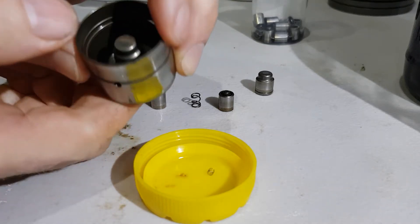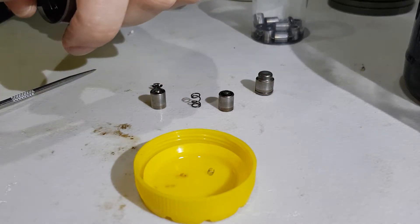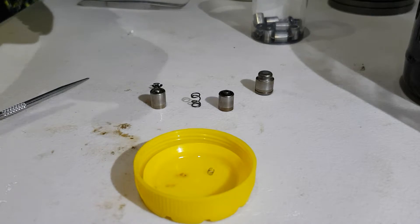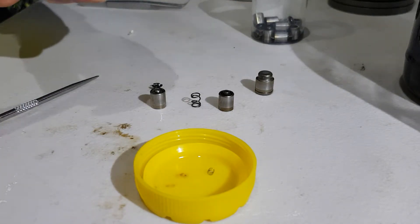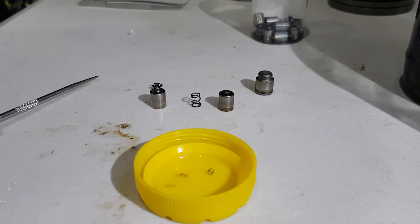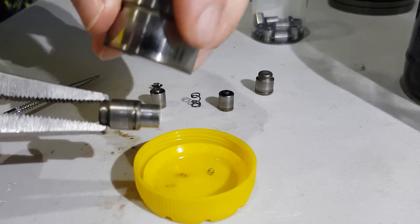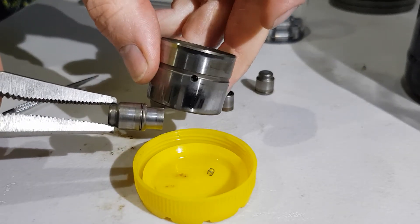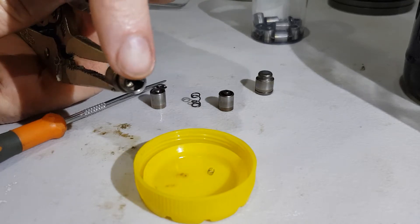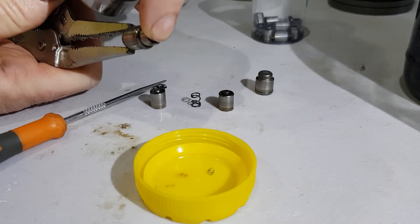As an added measure, you can fill the bucket up inside there with oil first, just to prime it so you don't have air under there. You can fill this orifice up with oil — it will fill up until it comes out of your hole most likely. But you will still have air inside most likely, and that's okay. You're not going to be able to get rid of all the air, but your oil pressure and the air will seep out the sides once you've started your engine and it's running.